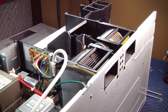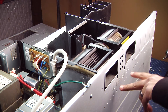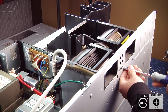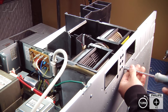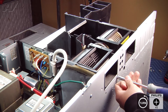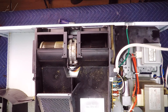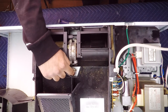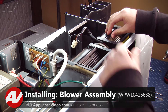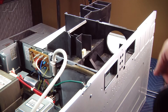Now that we have access to the blower motor, we're going to remove it. To remove the blower motor, we do have to remove the two number two Phillips screws that are behind the actual unit — they are hidden, recessed screws. Once the last screw has been removed, we can disconnect our Molex connector by pushing in on the clip and pulling it straight off. We can then take hold of the whole blower motor assembly and pull it straight up. We'll remove it and set it aside.